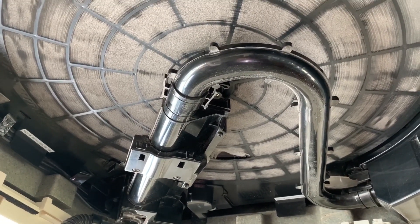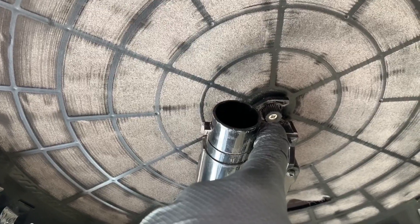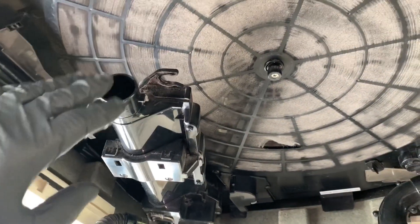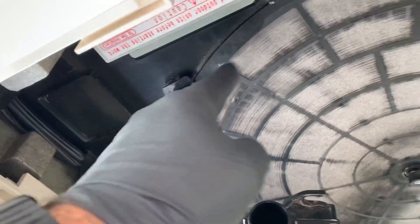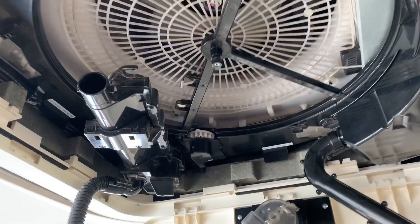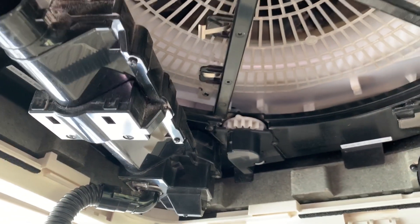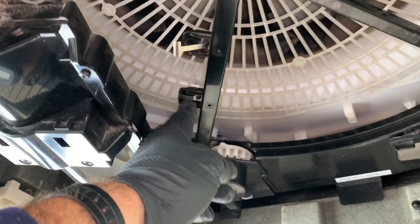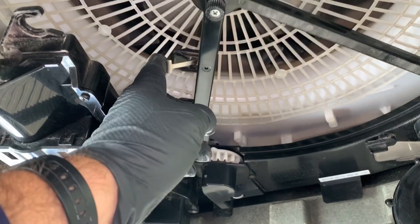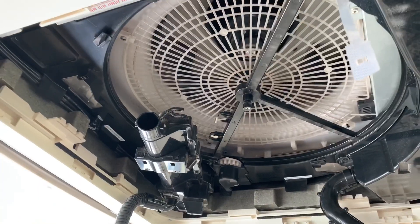The easiest way I've found to get the filter out on these is to take that S-pipe off there, then undo that center screw. Once you've got that screw undone, you can just lift that out of the way. Then you'll see there are a number of tabs — they just turn like that to allow the filter to drop out. That's the filter removed. You can see the filter motor there and that cog — that's what's going to spin the filter around. Up there are the prongs we were talking about. That one's bent right up so I'll have to bend it back. I don't know if it's these that are ripping the filter or something on the brushes.